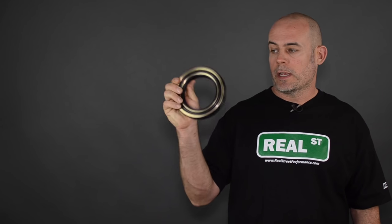As an example, I have an ATI ring here — this is the dampener. They use different durometer o-rings that isolate the hub of the crankshaft to the ring of the balancer, and they are tunable in some degree for different engines. They generally have a good safe setup for engines that are over the factory power level and will meet a class or NHRA rules.